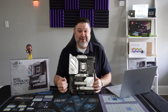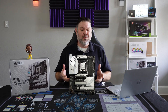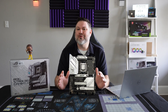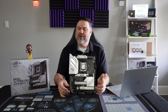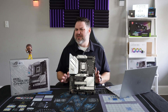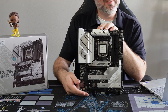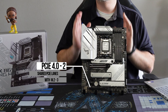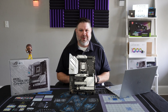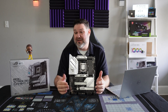Looking at PCIe compatibility, we have two PCIe 4.0 slots, one of which takes advantage of ASUS's quick-release feature to help you with installing new GPUs or reseating cards. That's not a necessary feature, but it's a great quality-of-life addition to have. The board also has two 1x slots. One key note here is the second PCIe 4 slot does share bandwidth with the third M.2 slot on this board, so that is definitely something to keep in mind if you're going to utilize all three M.2 slots as well as both PCIe 4 expansion slots.